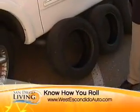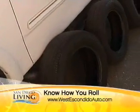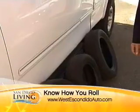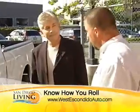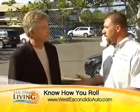The tread actually has something to do with your mileage. It can, because obviously tires, when they're worn out, don't grip the road well. You can have other issues — being out of round affects the driving of the vehicle. But more of a safety concern: if a tire gets worn out, cupped, or has steel cords showing, you risk the possibility of blowing a tire out and putting you or your family in danger.